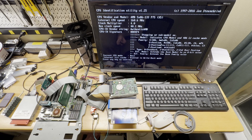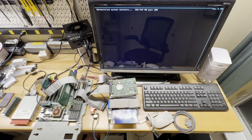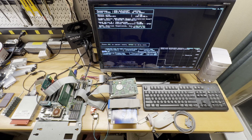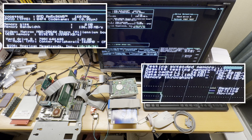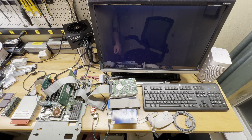We're at 160 megahertz on the processor, 40 megahertz bus. I keep saying 50 megahertz but I mean 40 megahertz. Let's do SpeedSys before Quake this time. Those numbers are either just barely as good or worse — that felt slower. I imagine the BIOS in auto mode tweaked my memory and cache wait states down. So let's go into the BIOS and max out everything and see if this board will run stable and if we can get some better results.